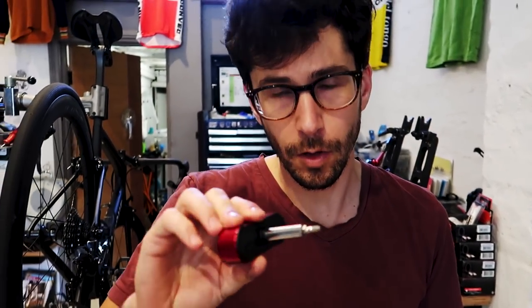When they say tighten something to four Newton meters, what do they mean? Well, literally that's the force that you're going to tighten the bolts to — four Newton meters. And you can gauge that with a torque wrench. Exactly. This specific one will click when it gets to five Newton meters. Five Newton meters is generally the tightening spec for a lot of the bolts around the stem and the seat post area. You do need to check and confirm, but most bikes with the integrated system, you're going to be there.